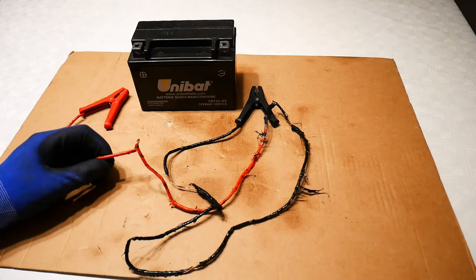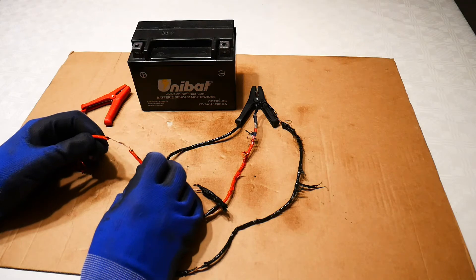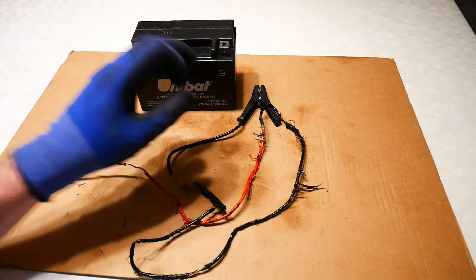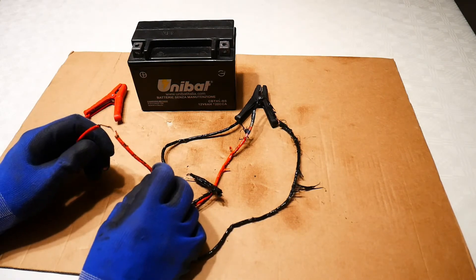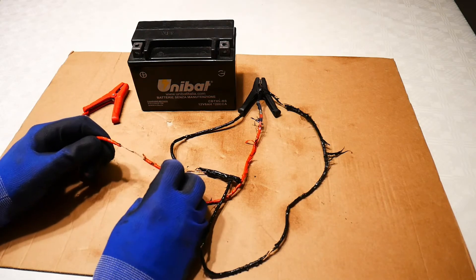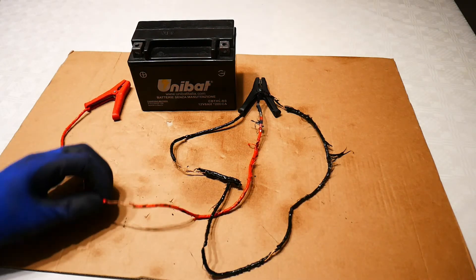If this was on your motorcycle, the exact same scenario can happen — shorting of wires does occur on motorcycles. This is why it's so important when working on the electrics of your motorcycle to always disconnect the negative terminal from the battery before you start working on any wires. Because if you connect a negative and a positive wire, you are potentially creating a short between the two terminals of the battery, and you run the risk of destroying your wiring harness in just a matter of seconds — before you even have time to react.